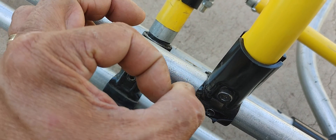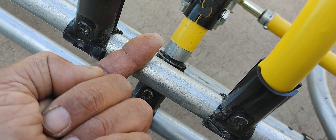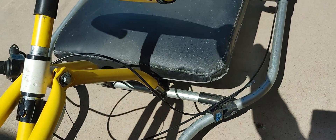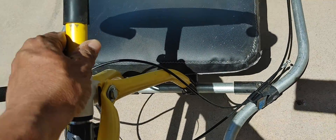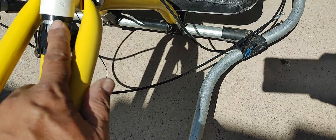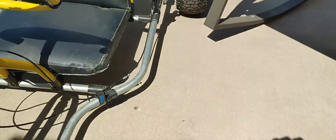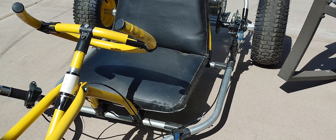Because the tubing's inside diameter is wide, I had to make plugs so that a 5/16 bolt rides inside with no play whatsoever. It's working really well. I still need to make some adjustments to my covers here since this is just a hitch tube — it shifted a bit while riding — but those are minor. Those are the changes I made to the front end. Now for the rear end I'm going to turn the car around to get out of the sun.